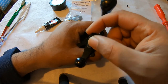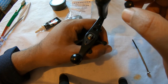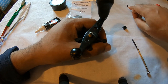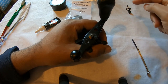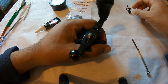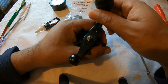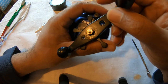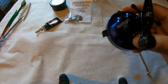I think it's a size 10 spanner that takes. That basically removes that. Now, I'm not going to put this down there yet because that screw first comes off, then that. So I know from past experience that is the order. I'm going to have to put this nut on, then put that on top and then put that little screw on. So that's the order. There's no pinion support in there, as you can see. Looks like it has actually been serviced. There's quite a bit of oil there, which is not a bad thing really.